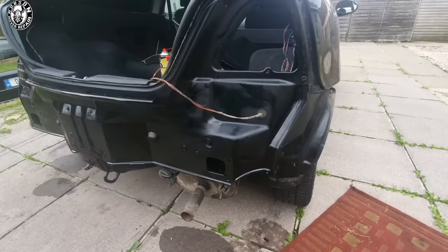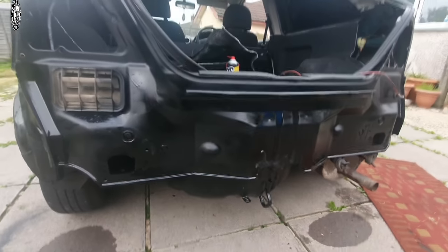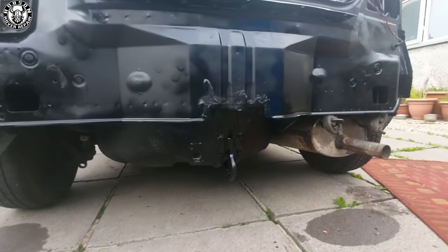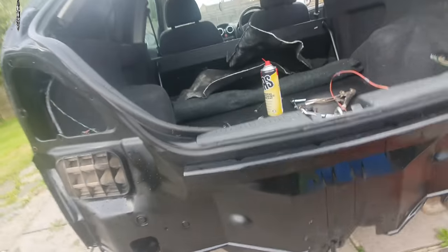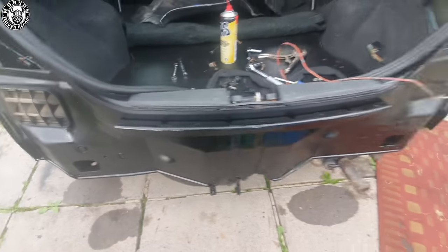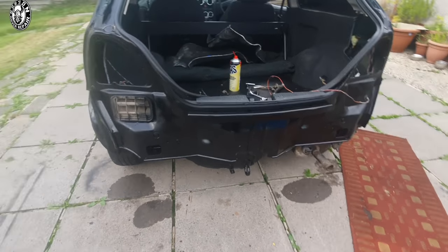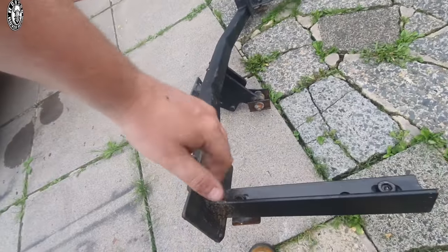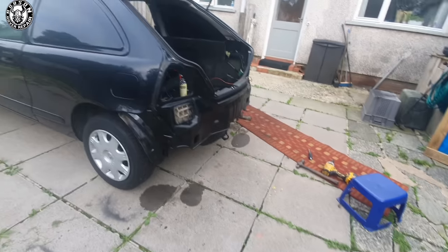Here we are - it's been about an hour between coats. We tidied up the back end quite a bit and iron oxided everything threaded at the hole underneath there. The wee shelf, as I call it, that the screw rivets go into was a wee bit rusty, so I did a bit of rust conversion on that and tidied that up as well. It's still a bit tacky to use yet. I'm going to disassemble this completely, clean it up a bit more, and tidy the ends of those threads, then we'll get this smashed on.